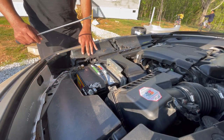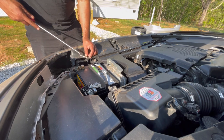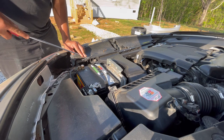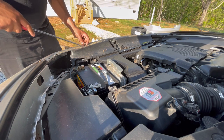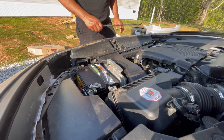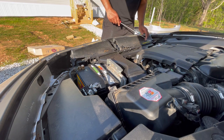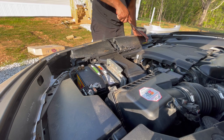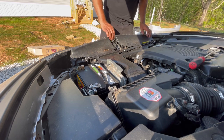We're going to start by removing all the grommets on this trim. Just dig in between the grooves with a pry tool and wiggle it upwards. These are a pain but I was going to replace these anyway. I already have a whole bunch of brand new parts and I'm slowly getting around to installing everything. These will be going in the garbage since I'm replacing this piece too.